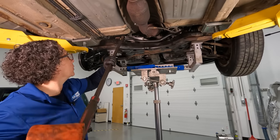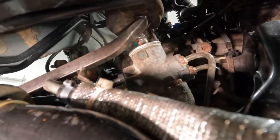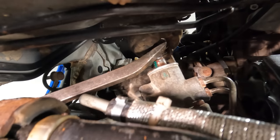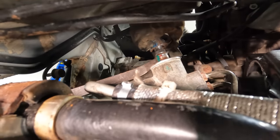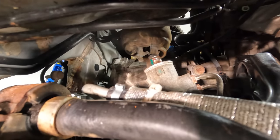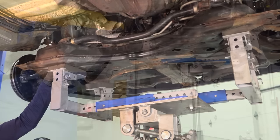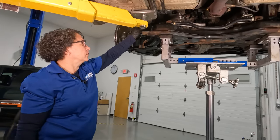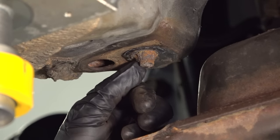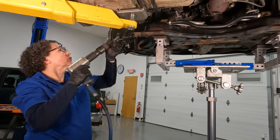I can see it's already giving a little bit of a bind, so I'm going to help it along and tap it a little bit with a rubber mallet. There we go — now there's no threat of any damage and we can continue lowering this. So now we've exposed this rotted stud — the broken-off bolt. It's in there pretty good. I'm going to hit it with an air chisel just to loosen up some of that rust and hopefully get a better grip on it with my twisty sockets.